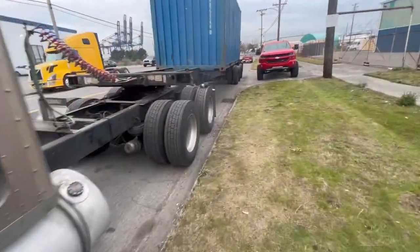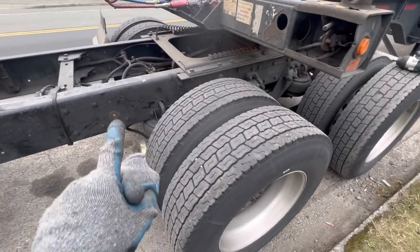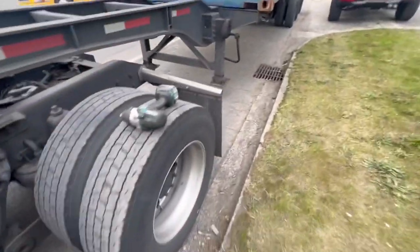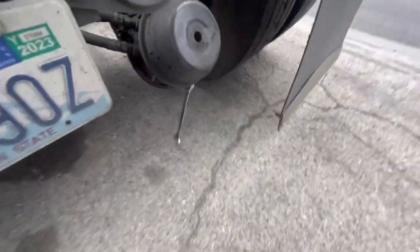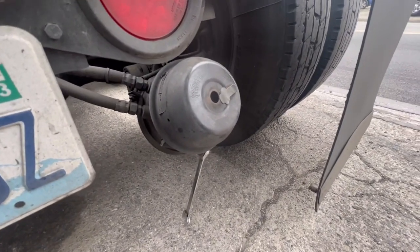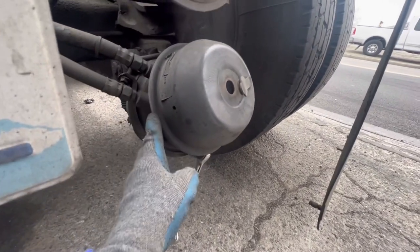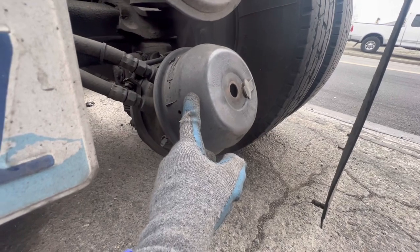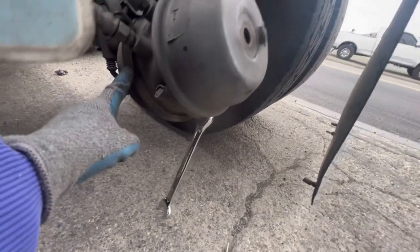We parked and heard a leaking brake chamber. Got to fix the stud right here — it got loose, so I had to take the fender off and get a new bolt. Got a leaky brake chamber, and guys, they're very easy to replace. The diaphragms only cost like eight bucks. This is a newer brake chamber because it does not have the clamp on the heavy strong spring that could actually kill you — it only has the clamp on this side.